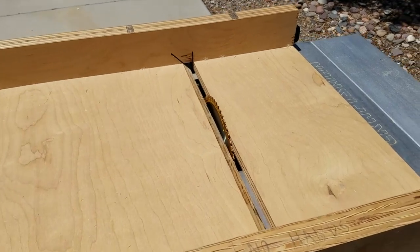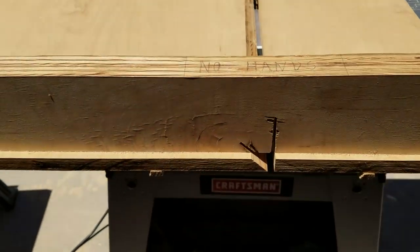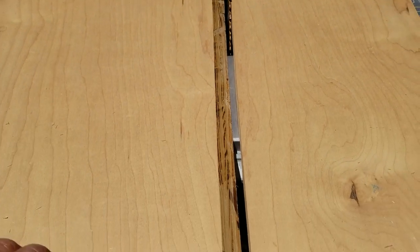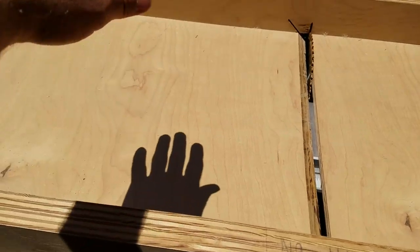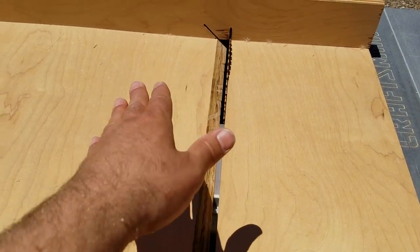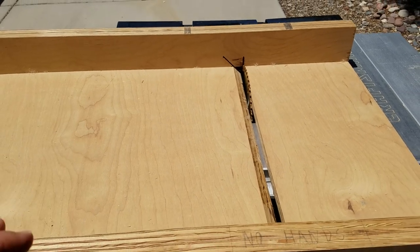All right, so I wanted to show you a little bit what's going on here. For you people that have not done woodworking, this is a nice little sled, and what it is, you got two pieces that go through the actual tracks that you see there. This allows you to get more precise cuts as you slide through. I think this is only 20 inches, so I had to cut some big pieces down first, and then I could put it in here and cut stuff on an angle or whatever I need to do. I've done a lot of woodworking in the past, and so I made this to do drawers and things like that, to just have perfect cuts.